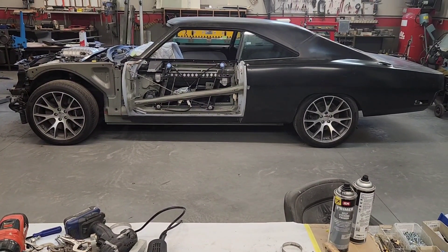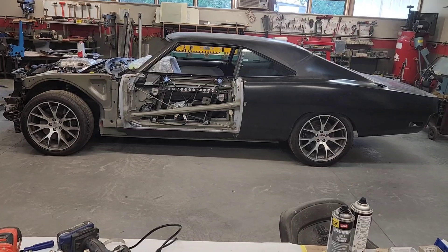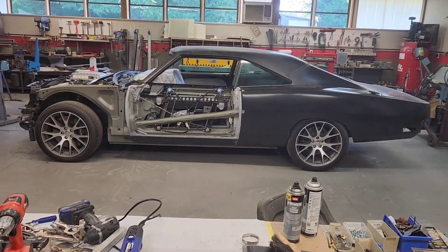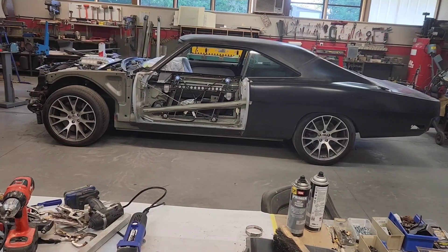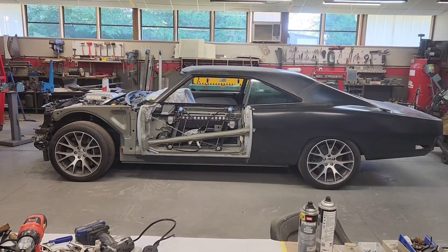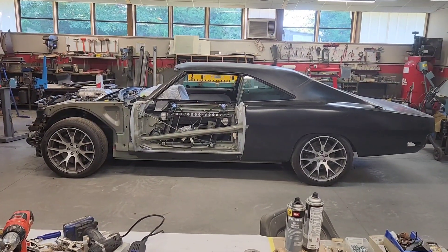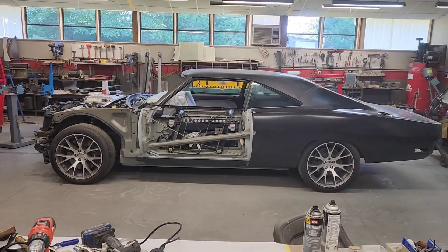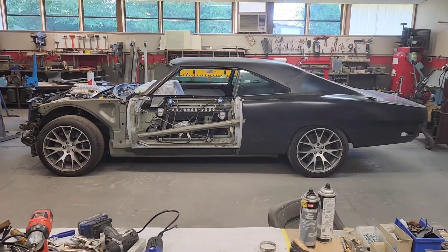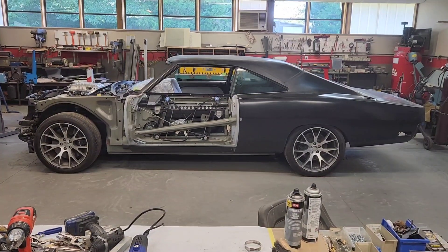This week I'm going to change the springs out on this car to get a better rake. Right now it is actually raked forward a little bit — you can see by the bottom of the rocker that it's about three-quarters of an inch closer to the ground in front. Visually the car looks pitched forward. The Daytona nose and everything fits about two inches higher than what I've got on my car, so I wanted to get mine a lot lower. I ended up changing just the front springs on that car, but this is a different suspension.